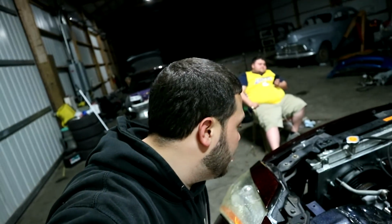All right, so the major oil leak is fixed, but I also found that the oil relocation kit, like the block that goes in the Canton pan, is leaking. So I don't know why. Maybe the O-ring was displaced or something like that, but the main leak is gone for now. I'm gonna put the alternator back on, put the belt back on, push the car forward so whatever does leak out will leak onto this, and I'll just make sure there's oil in it. We'll try to start it up again, and then tomorrow I'll have to maybe go in there, either get new O-rings or maybe add some black RTV or something like that. I don't know why it wouldn't seal up, but yeah, that's what I gotta do now.